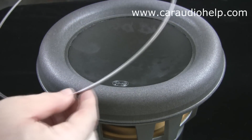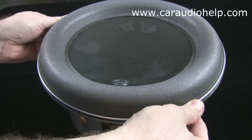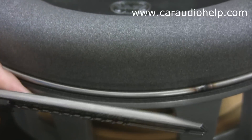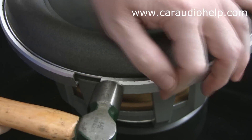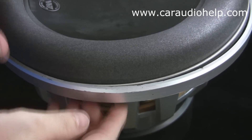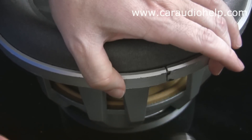Once the glue is fully cured you can mount the subwoofer into the enclosure and finalize the installation with the O-ring and clamp ring. First slip the O-ring over the foam surround and begin pushing it over. It will be very tight, so don't push one side down fully or the other side won't seat — instead work your way from one side to the opposite side, much like tightening lug nuts on a car's wheel. When the ring is almost all the way down it will be very tight on the new foam. To push it down the last little bit I found it necessary to use a small flat tool and a ball peen hammer, carefully tapping along the entire perimeter of the O-ring. Finally you can add the clamp ring — again I found it necessary to use the ball peen hammer to gently tap the clamp ring into place. Start at the joint edge and then move along the perimeter, being sure to hold the part you previously tapped in place or it will lift off. If there is a gap in the clamp ring joint, inspect the space between the clamp ring and the surround to see if any sections have pulled away.